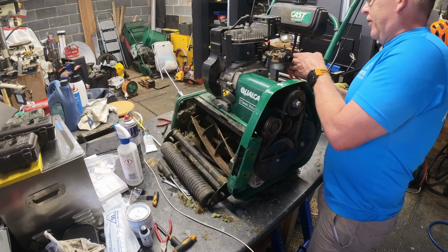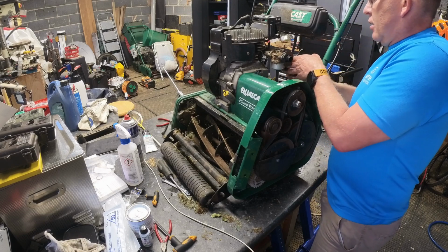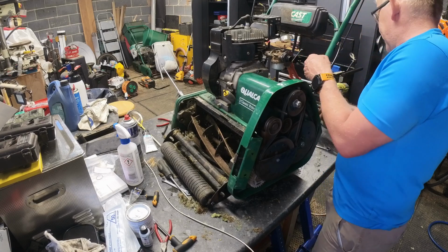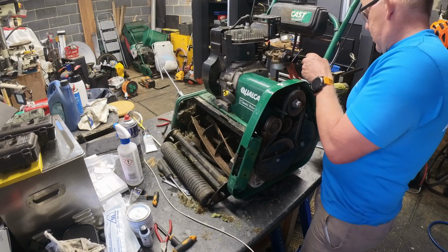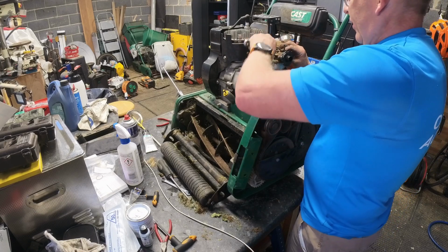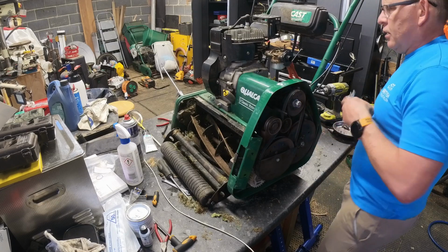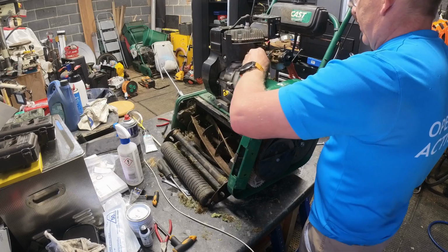We'll just go get the carburetor off, and we need to do the fuel as well. I don't know which to do first. These are flipping awkward to get off. They're a 9, I can't remember now, one of these. Seems to me they have got a weird size on them. These could very well be Imperial. It won't surprise me if it's Imperial. There's way too much slack on there, it's got to be Imperial. The 9 doesn't fit, but with the 10, there's too much slack on it.